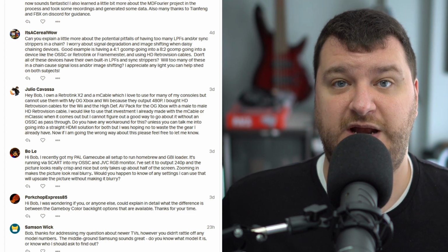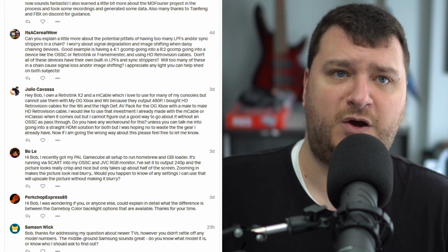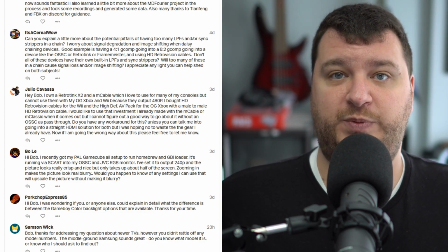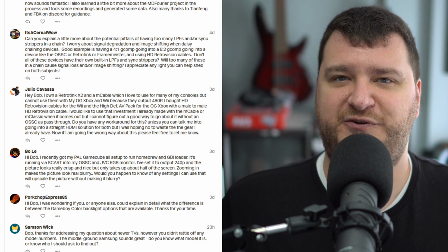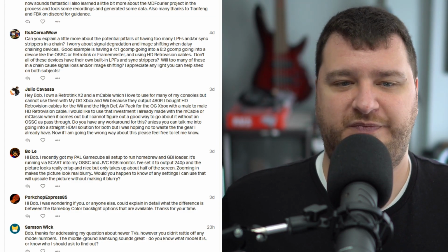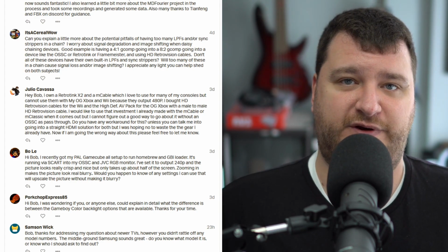And of course, if you have any mods that allow you to turn the filter off, such as the triple bypass, or I believe all of Voltar's boards actually, just pop it open and turn it off. I think it's just a jump. I think he specifies on his website. I can't remember if you need it jumped for off or jumped for on, but if you're using HD Retrovisions going into something else, I would just turn it off right there on the chip.